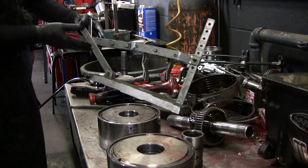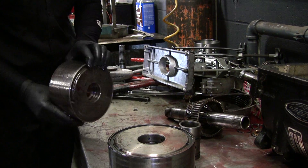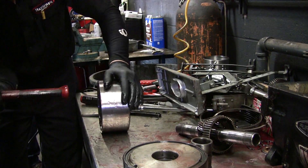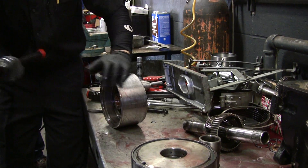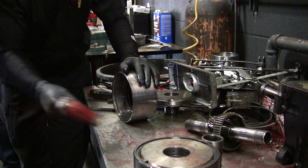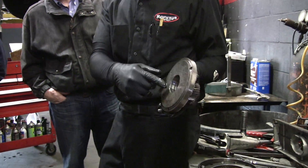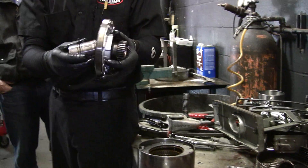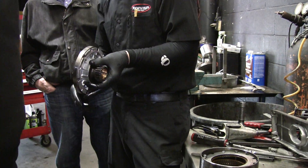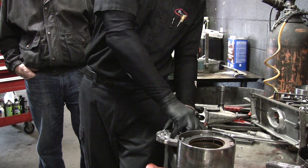Now normally it would pop out a little bit further, so this has to come apart. Now I can take a hammer and bang this and screw it all up, but take the plastic part — even a soft mallet I would not use on this metal at all. Now we're inside. This is the part that rolls on the center support. The fluid passages are in there and it has these holes in here. When fluid is forced into those holes, this piston should come out — and there it is.